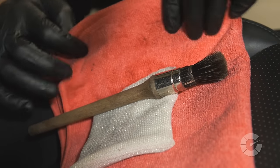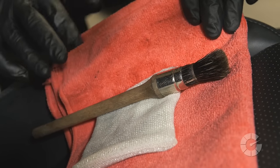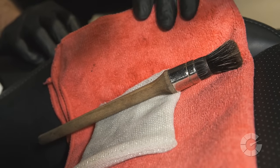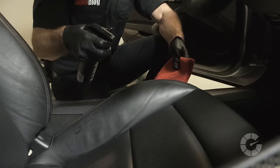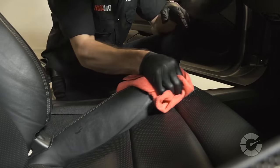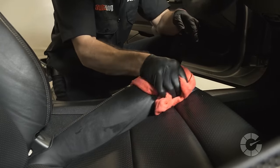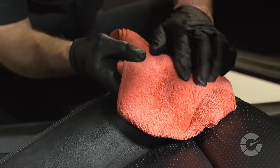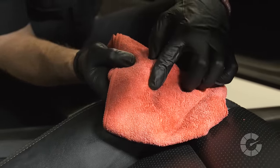There are typically three tools used when cleaning leather for varying degrees of cleaning strength. Always use the least aggressive technique that will get the job done safely. The least aggressive method is to spray leather cleaner on a small section of the seat and quickly wipe it with a clean, dry microfiber towel applying medium pressure. This is a fast, easy, and safe technique I use every month or so for quick cleanups.